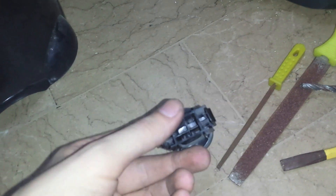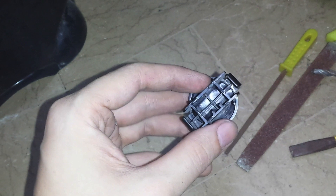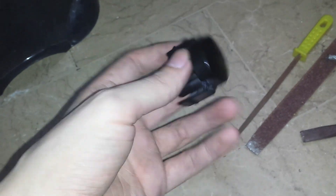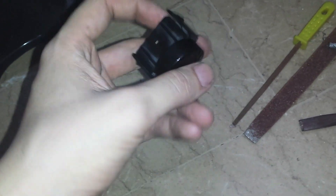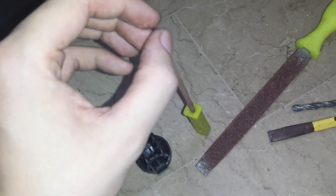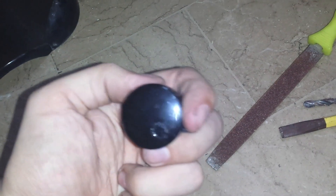I managed to remove it from the dash. I thought it was just going to be a face plate but there's quite a bit of plastic behind this. So my plan now is to just have one USB port in the middle. I'm going to use a chisel to chisel away some of that plastic inside, then drill straight through the middle, and then use a file to get it into a square USB shape.